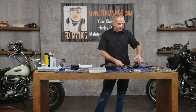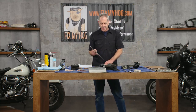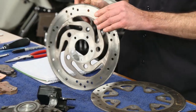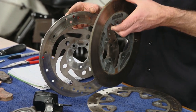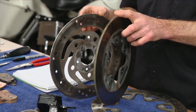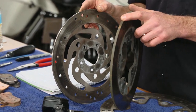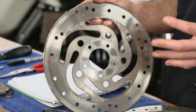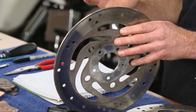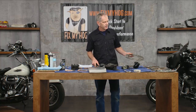Pump up your brake, make sure the brake light's working, set the brake fluid level. If you and your buddies are going on a road trip and your buddy says 'I just put brakes in my bike,' do them a favor and check the brake fluid level. Now, looking at brake rotors over the years, Harley's been trying to make them better. This is an '00-to-'07 rotor — compare that to the old Evo one. I'd say there's probably 10 pounds difference in feel, and look at the thickness. They over-engineered it back then. Now they make them thinner, lighter, drilled, trying to absorb heat so the rotor can actually warp and come back to its position.